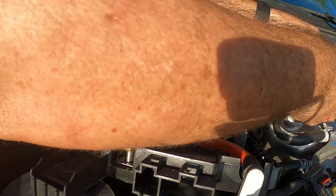Like I told you, it's a two-part tank. When it overfills it comes into this tank here — as you can see in the color, most of it lives here. When this tank gets low it's going to pull back through its reservoir. Here's our headache — our sensor that we always have issues with. There's no way of replacing the sensor; you have to replace the whole tank.